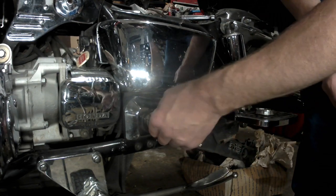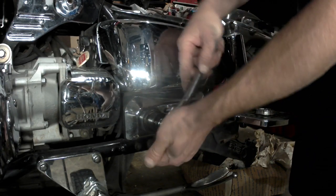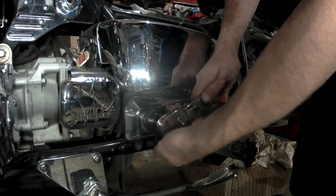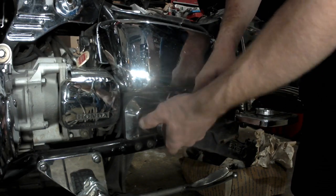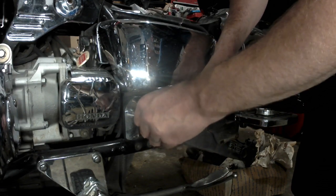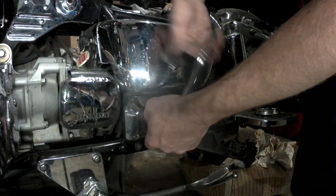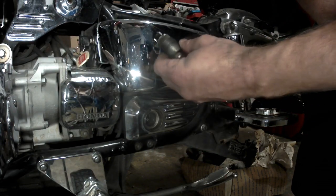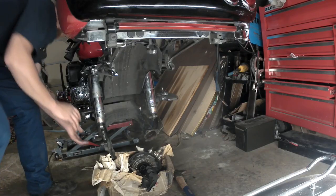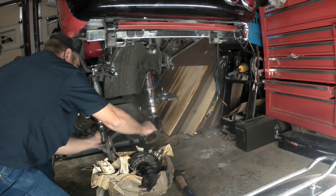Here's the problem I'm running into — we're actually now turning the bolt as well. That's why that tool has the hole down the center: when you go to torque it, you have to hold the bolt, because you torque the bolt first and then you have to torque the lock nut. So that's the lock nut. There's the bolt — that one looks kind of nasty. With any degree of luck, you should be able to wiggle the swingarm out of the rear of the bike.